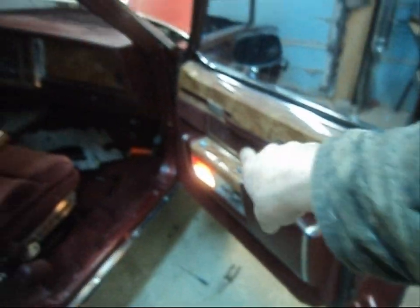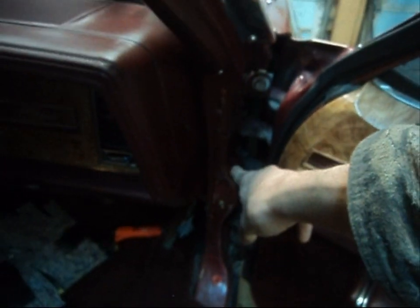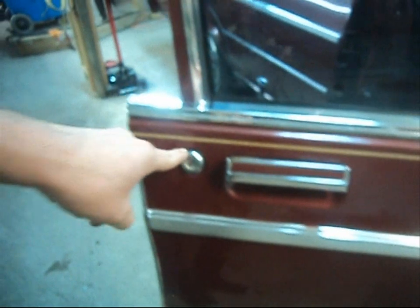What we're dealing with here is a little halo around the lock. A lot of younger folks might not know about this, but there is actually a light that illuminates in there — it's not a light per se, it's fiber optics. Yes, they did have that back in the day. There is a fiber optic cable that runs in between your door channel, all the way through the frame rail, and there is a 194 bulb in a socket that provides light all the way to the lock cylinder.